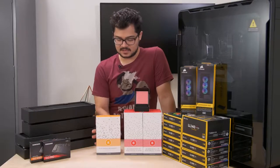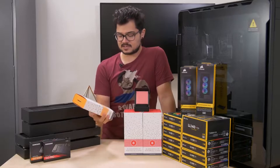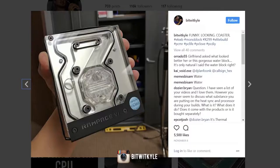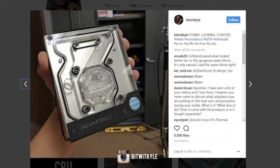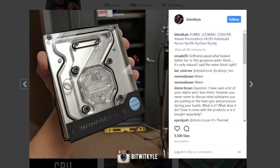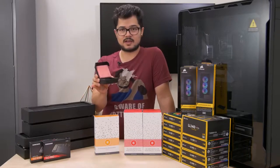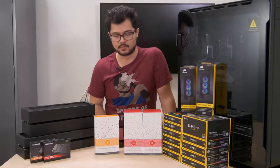Because of that and Steve's infinite wisdom, I've decided to invest in an ASUS ROG Rampage 6 Extreme monoblock that will hopefully lower the temperatures on our VRM enough so we don't encounter any thermal throttling, because the last thing we want is for this thing to be super nice and delidded and then get ruined at the end of the day by the motherboard.